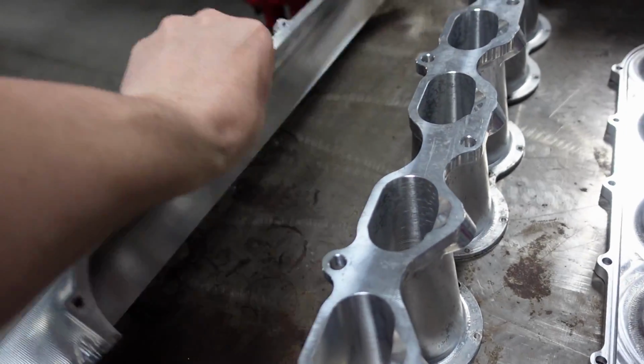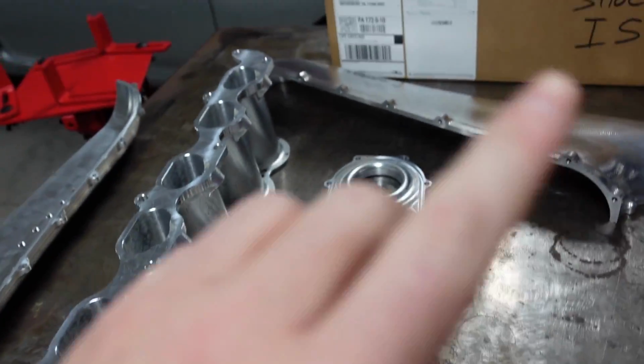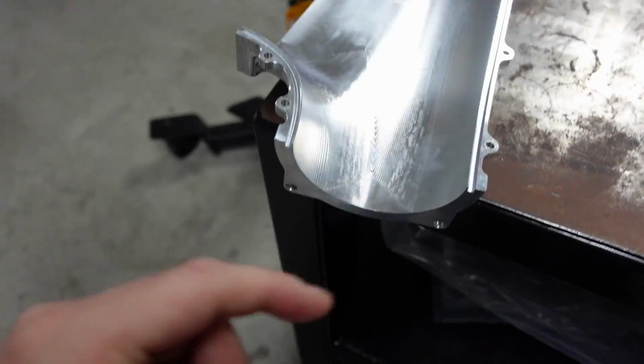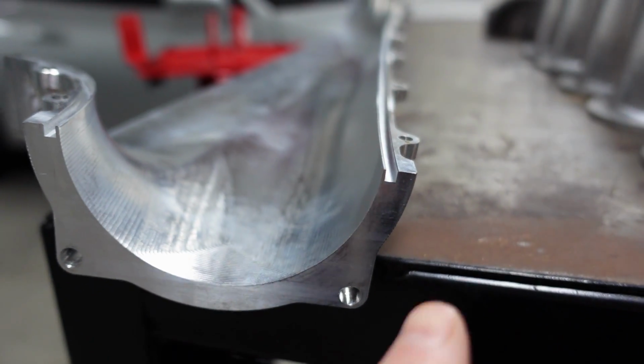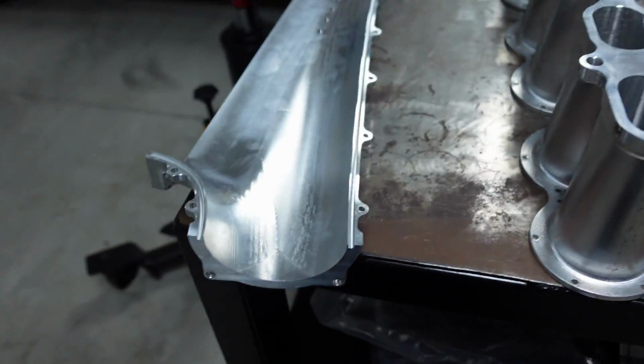They don't use a one piece O-ring. And same thing that sandwiches these together, okay? This is cut out and grooved for it to fit. This part of it's cut and grooved double time. What I mean by that is this. So you can see the C channel there, right? See the C channel? Here and here, this is one little piece of O-ring, another piece, and you just cut it flush with it, and then an adapter goes in the front.